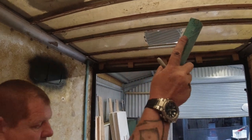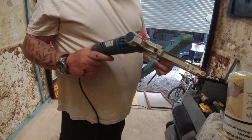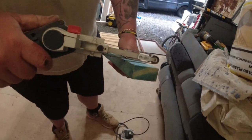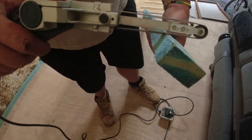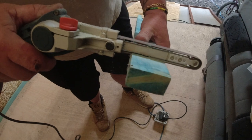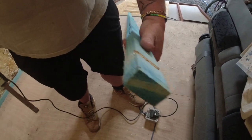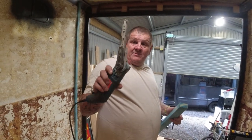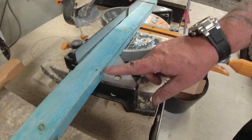This is quite easy to get out and I'll show you how we do it. If you're building vans and you haven't got one of these tools yet, get yourself one. This is called a power file or a finger file. It's literally a thin bit of sandpaper — it acts like a file but a motorised file. And there you go — it gives me a little lip inside. Trust me, worth every single penny when you buy one of these. I've actually got an air one as well, they are that good.